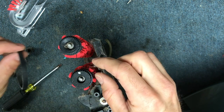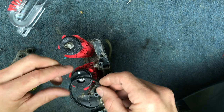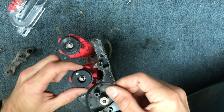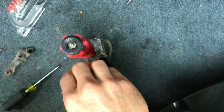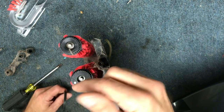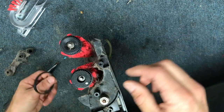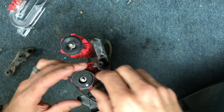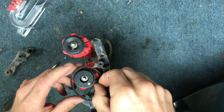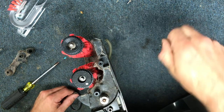If it's just the short belt that is broken, then you can stop here, replace this belt, and don't even pull the other side apart. You can just leave it as is, and you'll be okay. As long as you can spin these brush rolls, you know that your other belt is intact. So if you had just the back brush spinning and the front brush was not spinning, then you would know it's your big belt that's broken. Usually it's the drive belt that breaks because the motor is what breaks off the teeth of the belt. Comment below if your large belt is broken — that would be information I'd be interested in hearing.